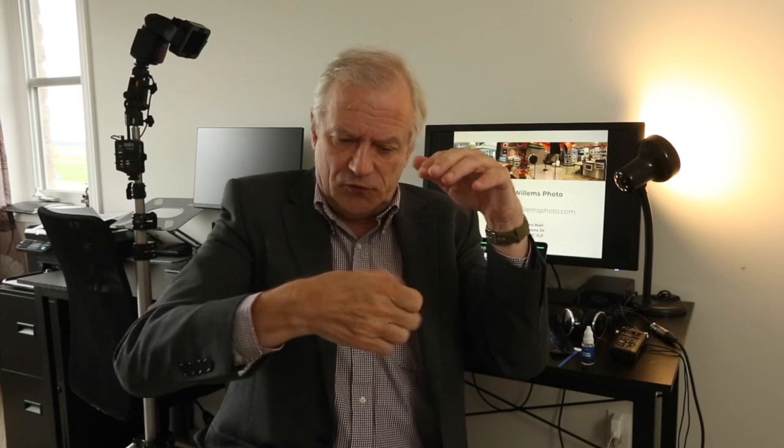The next step is to open up your camera, and you do that by using the function which a lot of SLRs have called manual cleaning. When you do that you need a fully charged battery — 100% — because the mirror is held up by the battery so you can see the sensor. Then you take a dust blower, a little bulb blower, hold the camera upside down, and blow air into the camera.